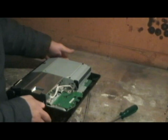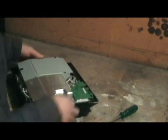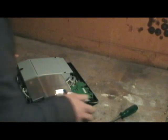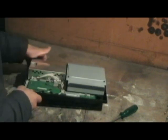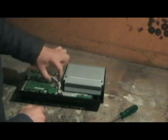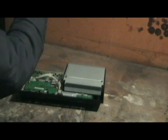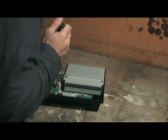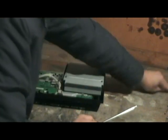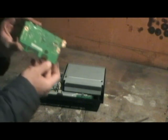We've already seen one difference with the 40GB as opposed to the 60GB, and that was the cover. Another difference is there are two screws on the 60GB which you'd normally take out with the cover, but you don't have to do that with the 40GB — they can be taken out later. That holds in your Bluetooth and Wi-Fi card. Pop that out, take out the two screws and the ribbon cable, and the card comes off.